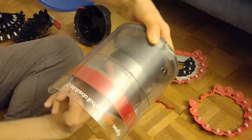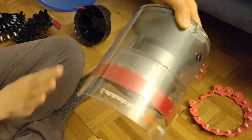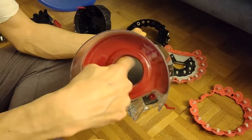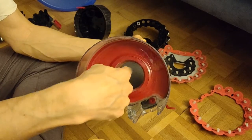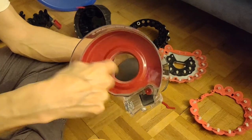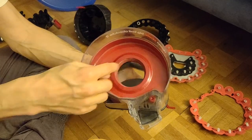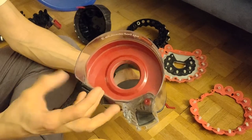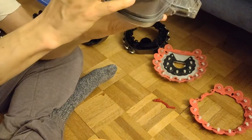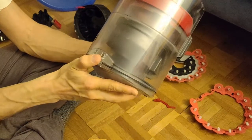And here where you probably can see my finger hit on it, here it opens. So it comes in on the outside, and it opens, and it gets smaller, so that it will speed up, probably, as it gets smaller in diameter, it speeds up. So the large heavy dust will release from the air, stay on the outside on the wall, and once it loses its speed, it will fall down.